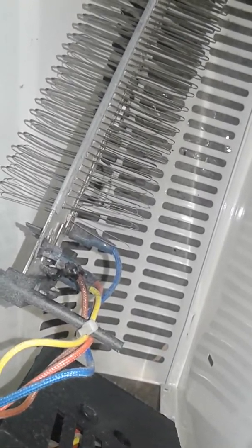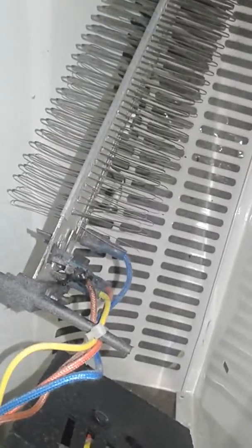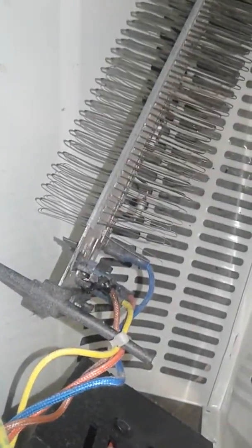When it was at full power, when I turned it off to half power it came down a little bit but it was still arcing. Then when I turned it back to full it started arcing even more, so I just unplugged it. Just shows you guys - you've gotta check your heaters. Not pull them apart, but just do a visual inspection to see if there's charred bits like that. That's extreme.